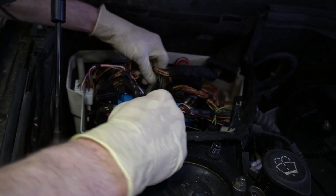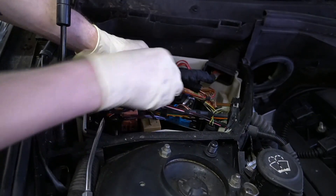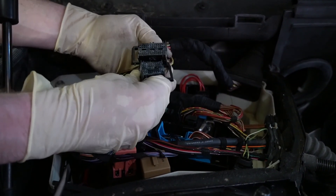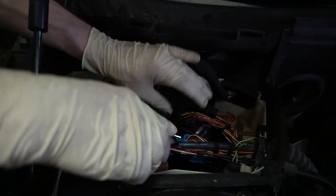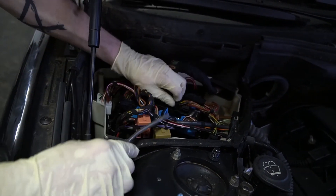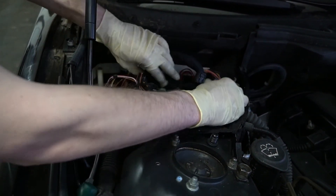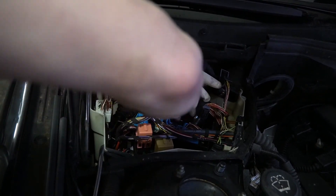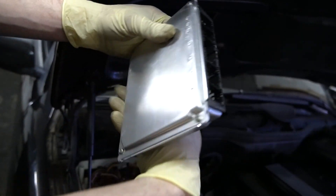As of now I can already tell that there is water in the DME because I can see corrosion on the plugs. See all that? That's all water corrosion. After you have all those pulled out, this one's another one you just pinch and pull. There are two tabs back here actually holding the DME into the bracket — pull that out. And here's your DME. If you look, that is significant damage on the outside of the DME. We're going to open it up and see what's going on inside.